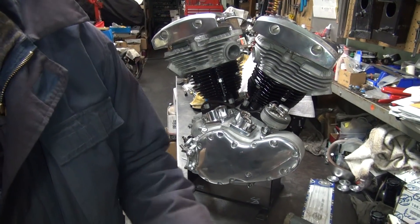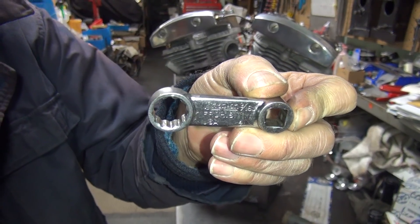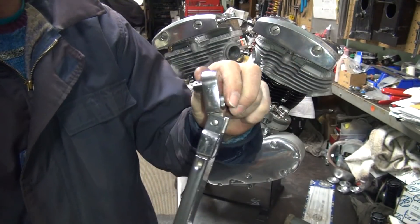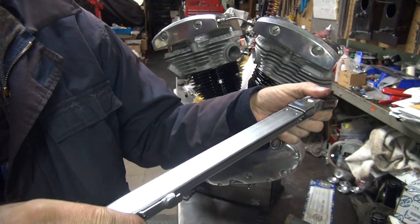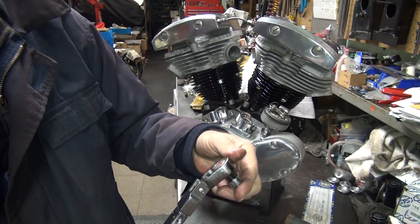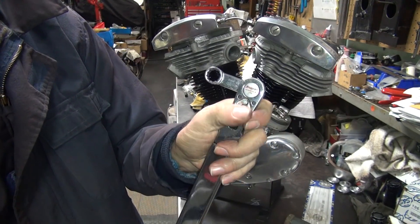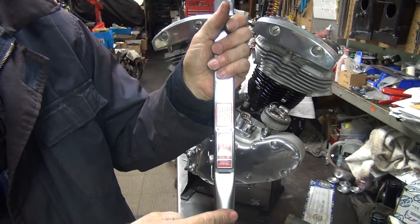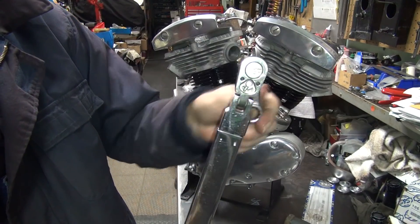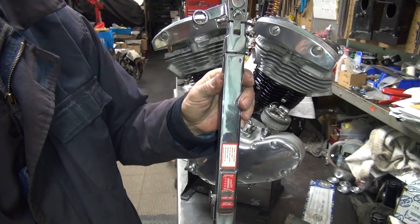For torque I use my torque adapter — snap-on torque adapter. You have to figure out what that number is. And I've got my flex-head snap-on torque wrench. Flex-head means you can angle this down or up depending on which side of the V you're on — very important, makes a big difference. So when you're at 90 degrees, the torque is what it says on the dial. If you're up here you get more torque; down here you get less torque, because the length between here and your beam is different.